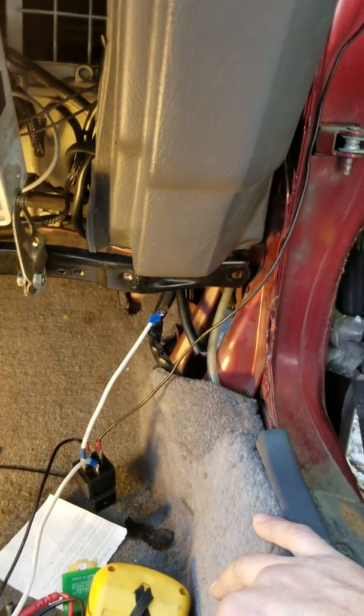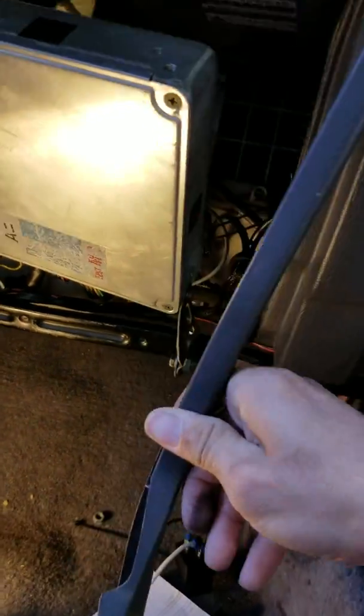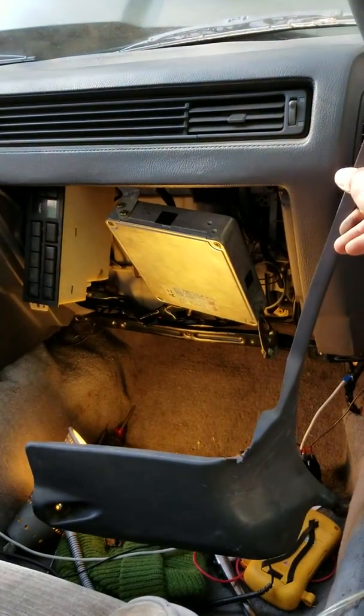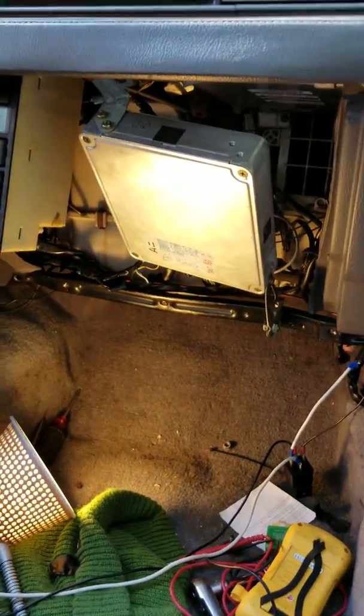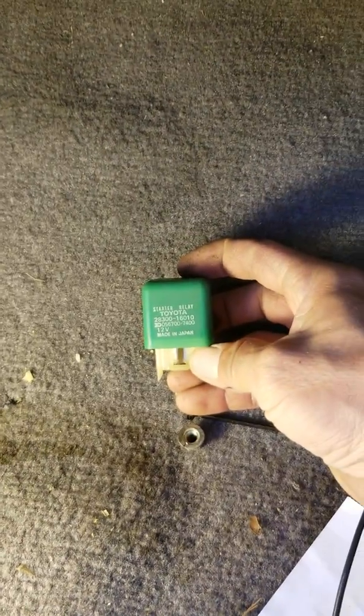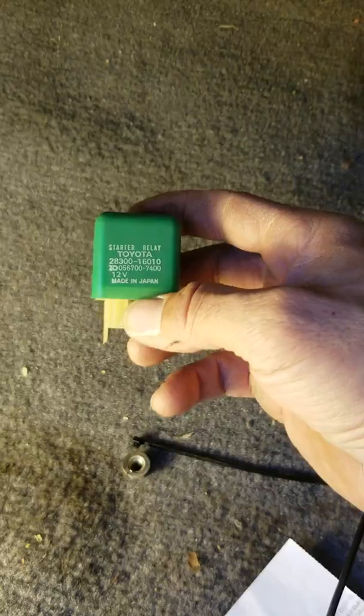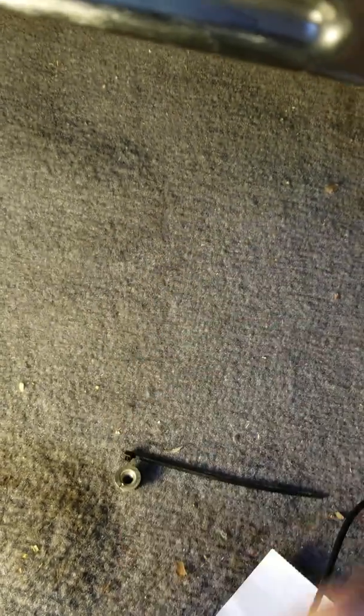The starter relay is under your passenger side kick panel, right here. There's a bolt at the bottom — a 10 millimeter bolt — take that off and pull this out. Under the kick panel you'll find this circuit board, and this green relay is in there, and that's your problem. You can go buy one of these on eBay and hope it works, or buy a brand new one from Toyota and pay a good amount of money for it.